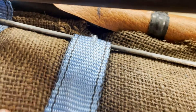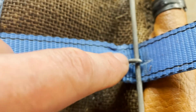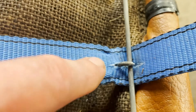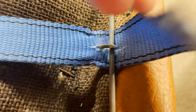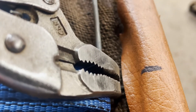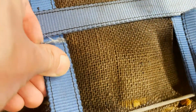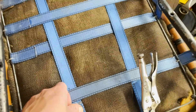The epoxy's cured and I've pulled the clips on the other side as tight as I can get them — pretty tight. I hooked the metal clip through the strap and pulled it tight, then grabbed onto the hook with a pair of vice grips and forced it back up into the hole. Now I'll apply some epoxy to all these ends of the straps, clamp it down, let it set up overnight, and this seat should be good to go.